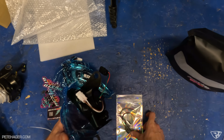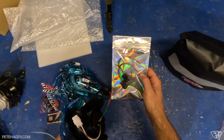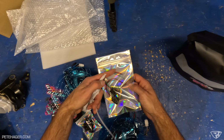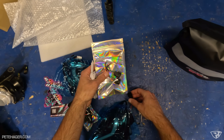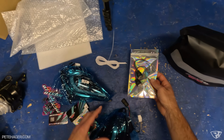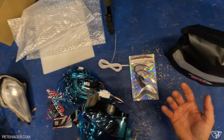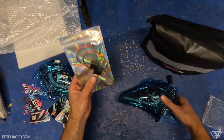The nice thing about this little expansion they have, which is called Harn-7, is that it would allow you to hardwire the white to the red or the green, and then you can plug this in directly to the headlight. Essentially this allows you to make your headlights removable without having to snip the white wire every time. And this is an excellent route to go if you don't get the plug and play street legal harness. So that's a little overview on what this little harness is for.